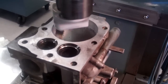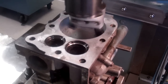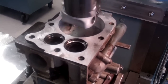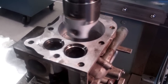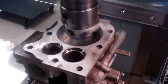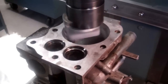For as bad as this thing smoked and how much wear I thought it was going to have when I took it apart, the guts didn't look too bad. The crankshaft looked good. The connecting rod was a bit worn — I've got a new connecting rod to put on it. The wrist pin had a little wear, though actually it was more the piston bore than the wrist pin. But it was smoking and had a knock in it. All in all it wasn't too bad. The valves were in good shape and I was a little surprised at exactly how good a condition it was in. I suspect it's going to run pretty good.